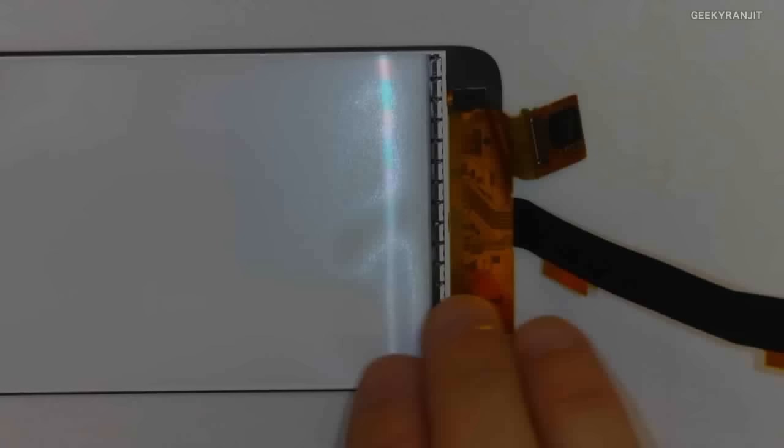And it's 4, 8, 12, 16. So we're right. It is in fact 16. And I think you can understand how we couldn't have done 16 if the display was a little bit narrower, right? So we made the display slightly wider by going to 5.15 so that we could fit more LEDs. The way that we laid out these LEDs and how close they are to each other was actually the result of a lot of R&D. Because if they're too close to each other, they can actually heat up and they can start to fail.